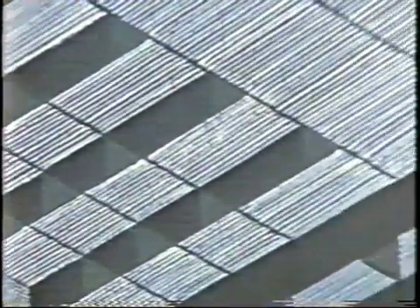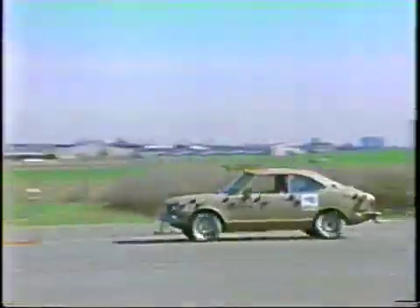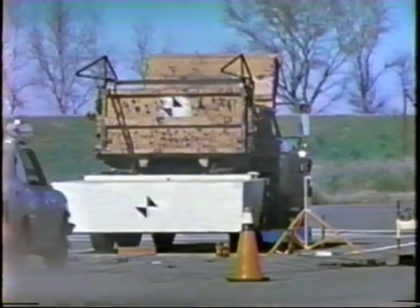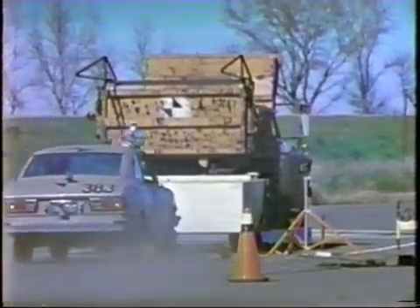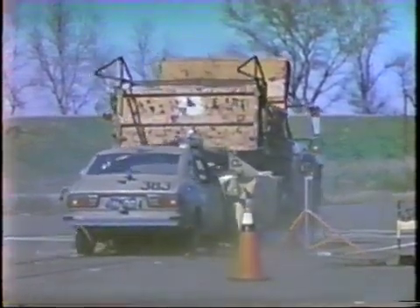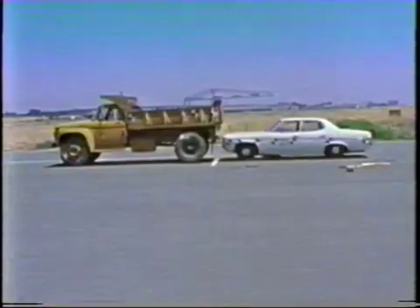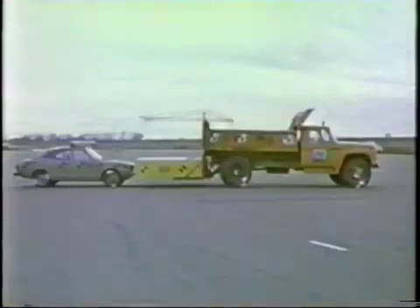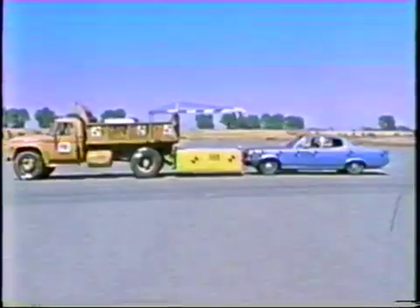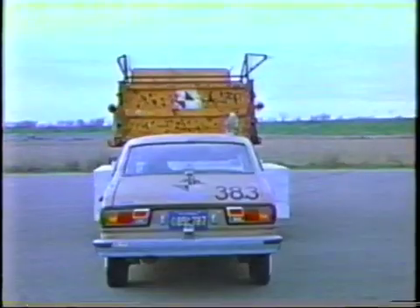In the initial design, the attenuator structure contained a series of sections, or cells, of honeycomb material. This design was developed to provide a suitable lightweight truck-mounted attenuator for both 4,500-pound and 2,200-pound vehicles. In each test, the car was self-propelled and kept on line with a cable guidance system, and released a few feet before impact. A speed control device on the car maintained the desired impact speed. The ignition was cut off just before impact. The cars and trucks were both in operating condition, free of body damage or missing structural parts. For all tests, the trucks were parked in second gear and the parking brake was engaged, and all were hit from the rear.